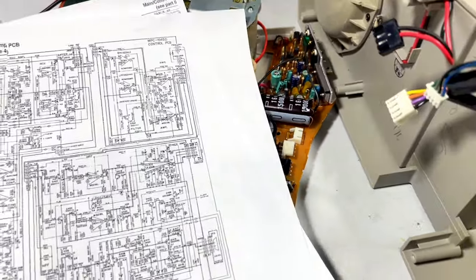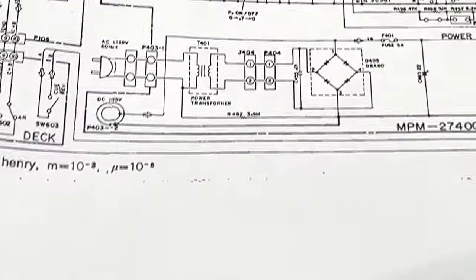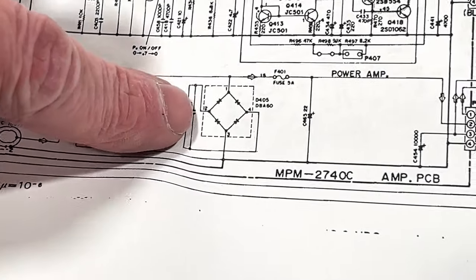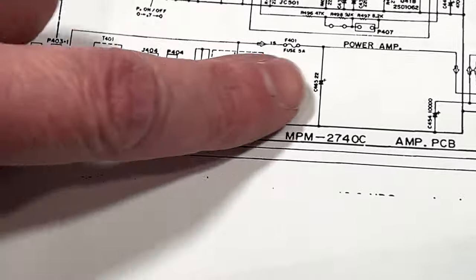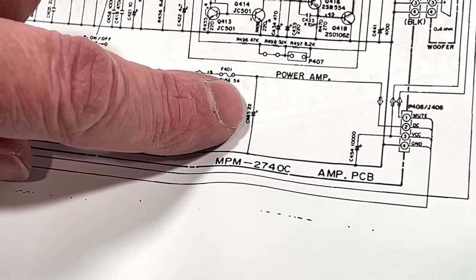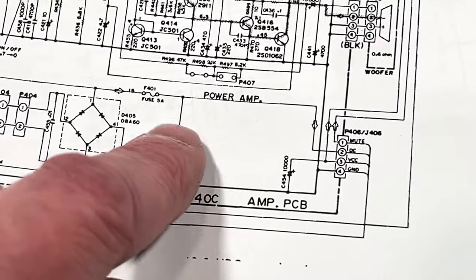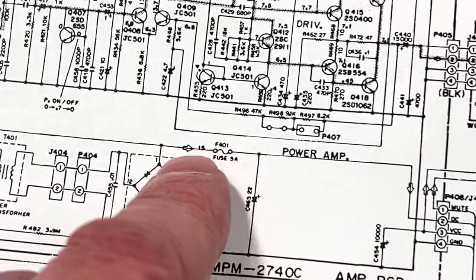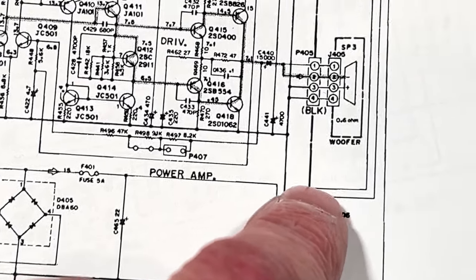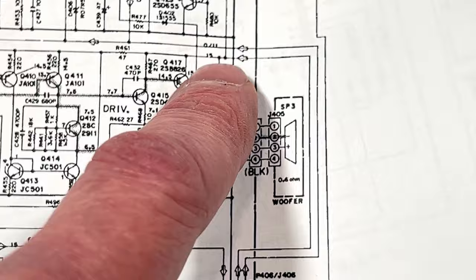That capacitor is, if I can show you, it is, where is it? Right there. And I checked this capacitor to see what voltage was across there, and I got 18 volts, which is not what this should be running at. As you can clearly see, she's got 15 volts there. And it goes 15 volts all the way around the unit. See, that's the same rail right there.